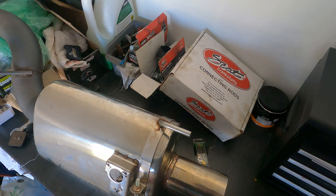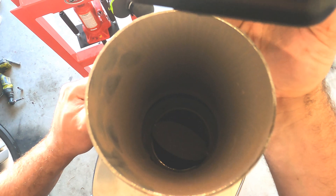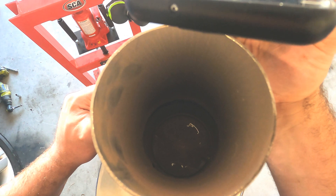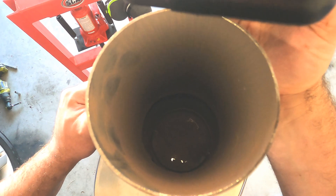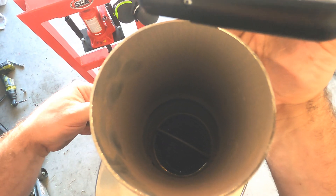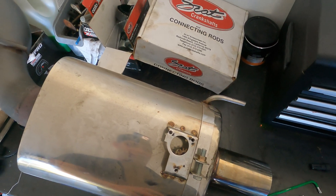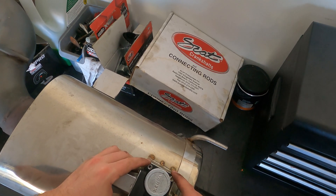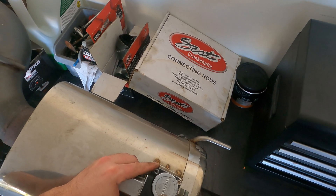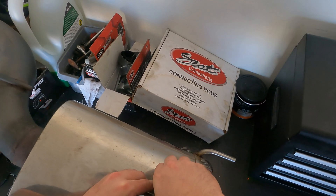So I will show you what it looks like internally when I operate the valve. This is basically what will happen when you're driving the car — you can close it off, open it up as you wish. It basically bypasses the exhaust through the muffler and the muffling elements and allows you to drive around quietly when you want to, which is quite a nice feature when you have neighbors. So now that we have the valve in the open position, we can reinstall the motor. It's just going to sit on there and lock that valve in place so it can't move from the open position, and we can enjoy the car in the meantime while I sort out the issue.